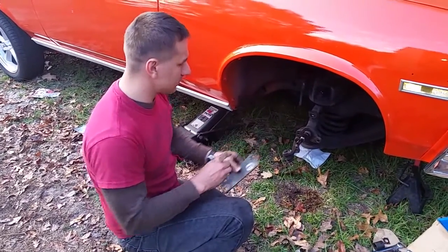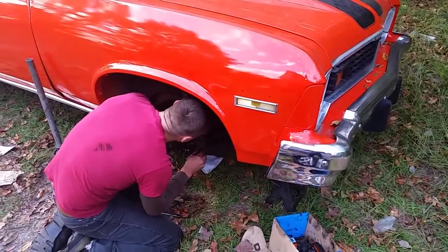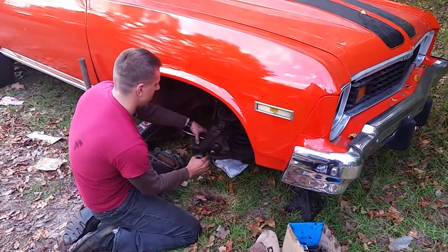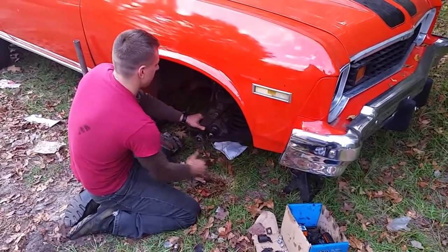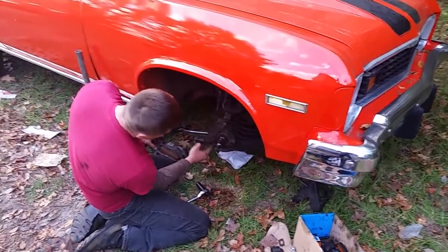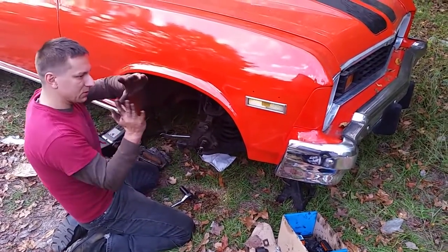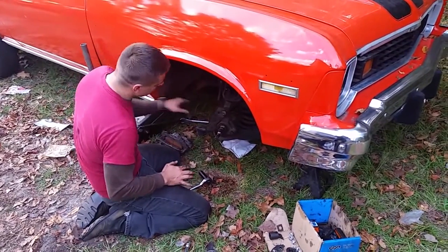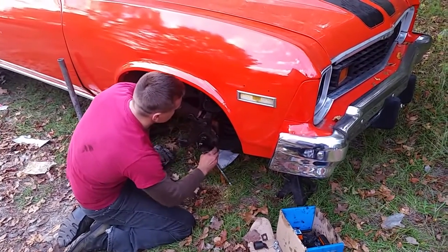These are the BRP Hot Rods plates. I got the bracket on, the modified bolt on, and I'm putting the two steering arm bolts on. They're two different lengths so make sure to get the right ones, otherwise it'll be too short. Under this bolt there's a little spacer — just a washer that goes under there and keeps everything perpendicular to the spindle. You don't want your calipers sideways. It's nicer if everything's parallel and perpendicular and working at the angles they're supposed to work at.